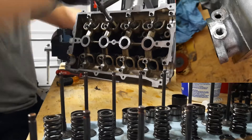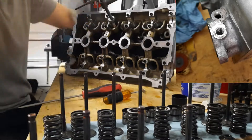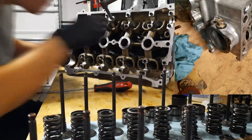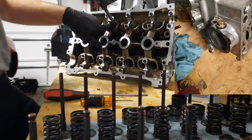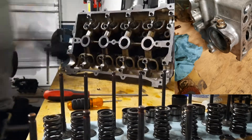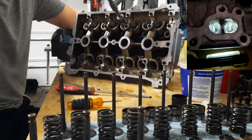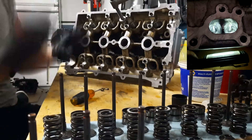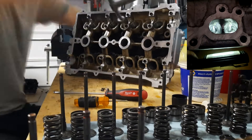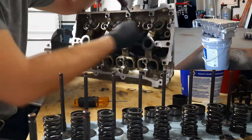Here's a picture of the cursed water plug — rather than deal with it later up against the firewall, I went ahead and drilled and tapped it with a metric tap, and there's a bolt in it with thread sealer, so I'll never have to worry about it again. Here's a picture of the polish I did on the exhaust ports — nothing crazy, not a mirror finish, but I figured while I was in there I might as well try.